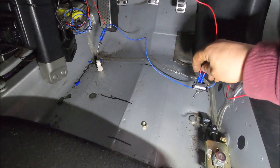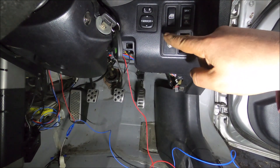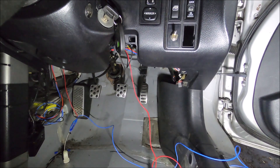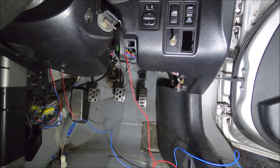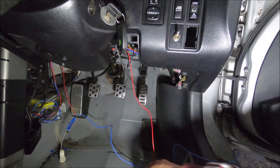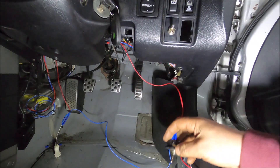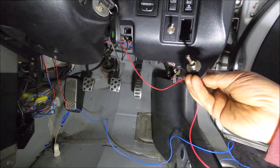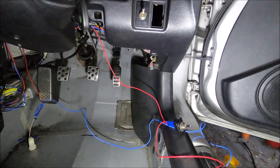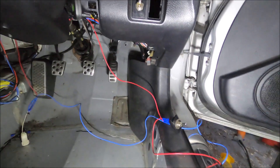For the sake of a tiny bit of extra wiring, it's worth a try. I'm going to have the rolling anti-lag switch there, and one to open the anti-lag valve, which is reusing the EGR pipework. I don't think the EGR pipe is big enough to have much of a fresh air anti-lag effect, but I want to try it because nobody seems to have ever tried it. I don't just copy everyone else - I use my own imagination. If it works, great; if it doesn't, at least I'll know.